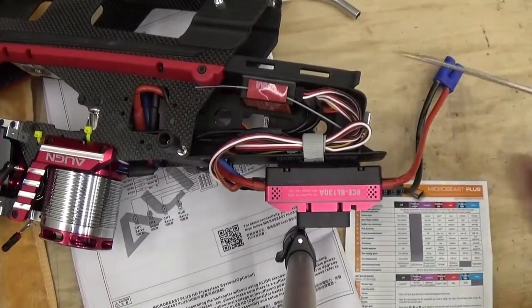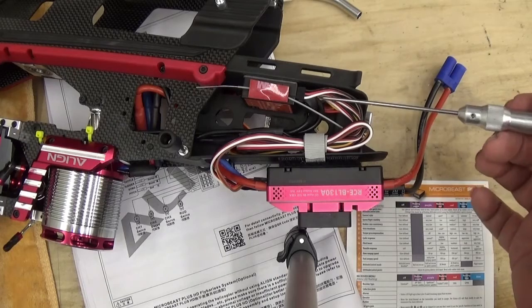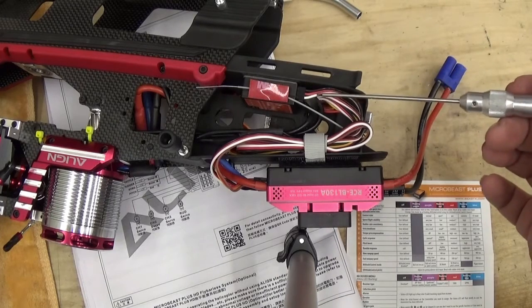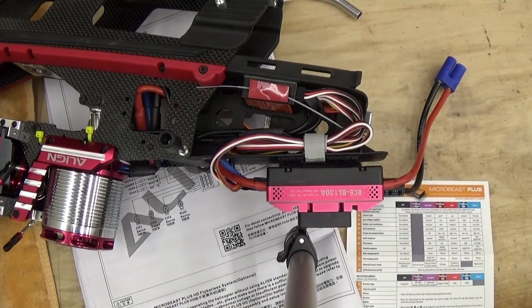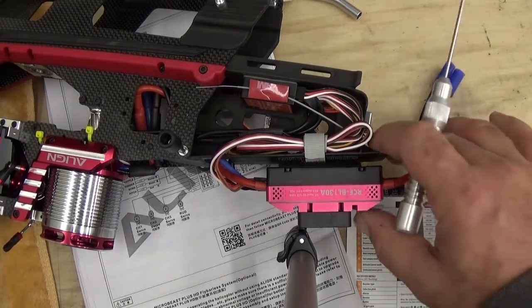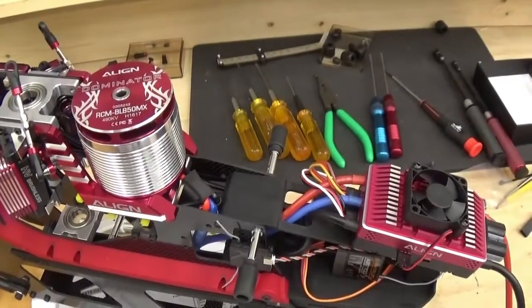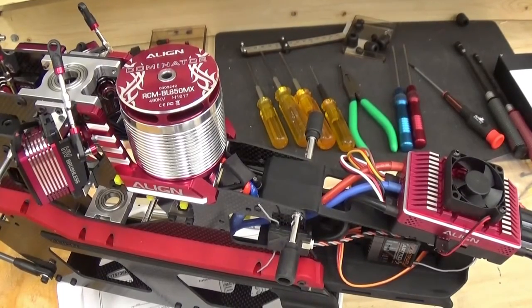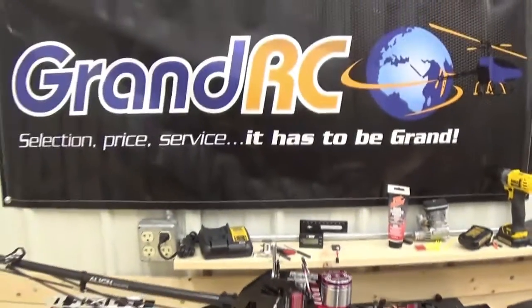Looking at this in the actual helicopter — this is the far side of the fly barless. The rudder is on the very top, then the cyclic servos, the elevator servo a little further down, and we wind up with the throttle cable and then RPM signal and power on the system connector. After several different layout attempts, I think this is the absolute best for the T-REX 700X. We're going to finish putting this together over the next day, get the rotor head assembled and put back in, and this one will be ready for a test flight. I'd especially like to thank Grand RC for giving me the opportunity to do these videos.